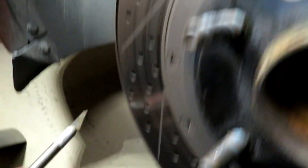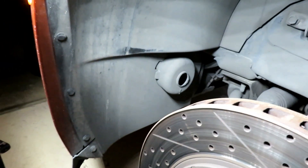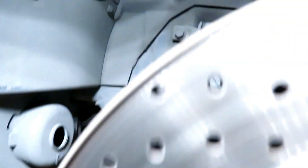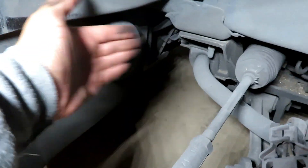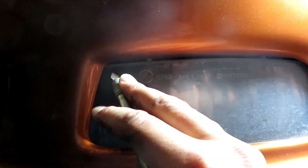We already have an existing brake duct that comes with all base model Corvettes. There's a little tube that S's down and draws in air from underneath the car - this big hole right here is where it's pulling in air to cool the brakes. But as you can see, it's not even directed towards the brakes. So what we're going to do is use this existing hole, but we're going to be cutting a path, ducting to the front of the car where air is definitely flowing in. I'm going to etch a little line to give me a template to cut where the fog light is around the bumper.